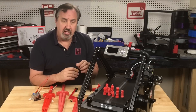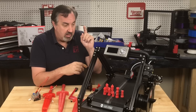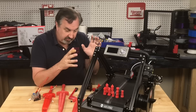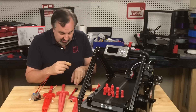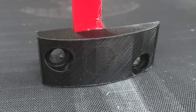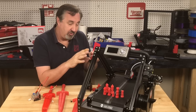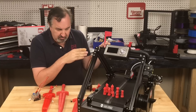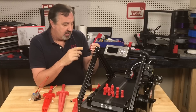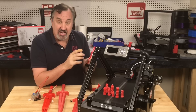They include Black Belt Cura on the SD card — a Cura fork shared by the high-priced Black Belt printer for belt printers — with a profile for this machine, but it only runs on Windows. As a Mac user I had to dig out my Windows laptop. I sliced a flag base that I print in my print farm and set up a profile to print 100 of them continuously. It printed 99 out of 100 perfect; one had a slight mid-print shift. I printed another 100 and got 98 out of 100.